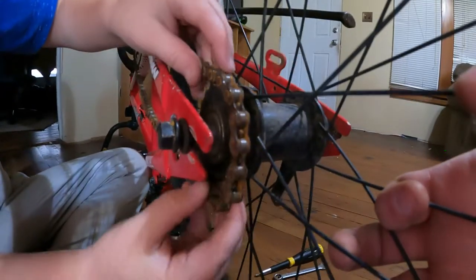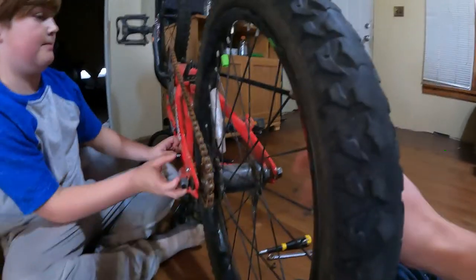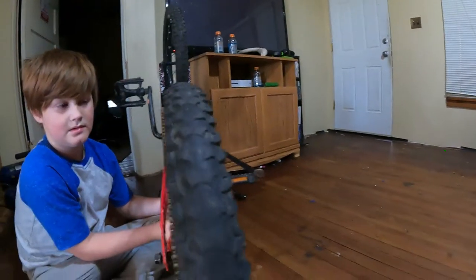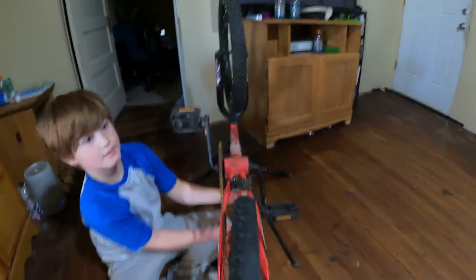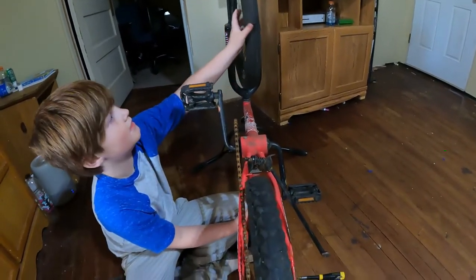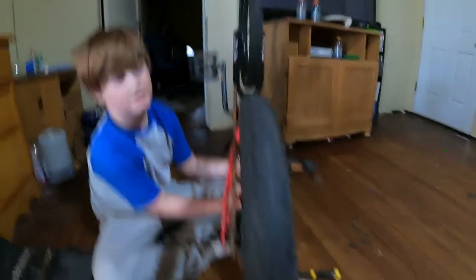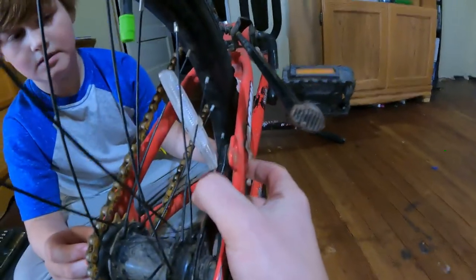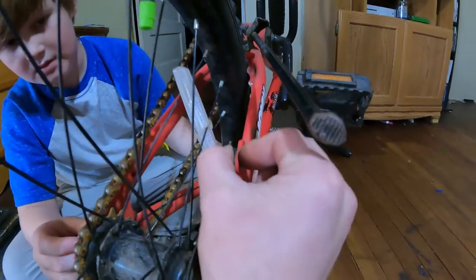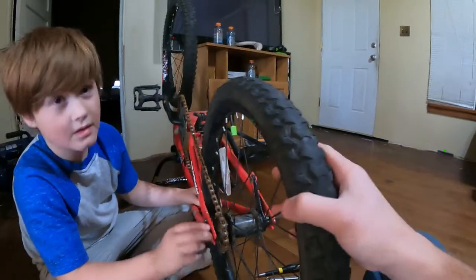Slip your chain back over. Since this is the back wheel, you want to pull it back but make sure it's straight — right now this wheel is totally crooked, so you want to straighten it out like so. Then go ahead and tighten both sides of the bolts down, and if you have one of these little secure brackets, make sure you bolt that down too. And there you go — you've changed your bike tire!